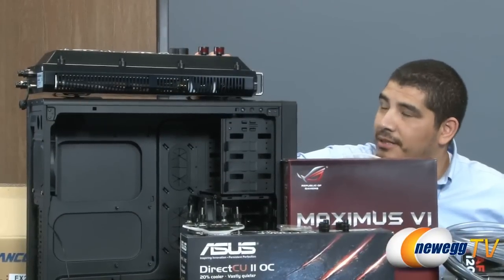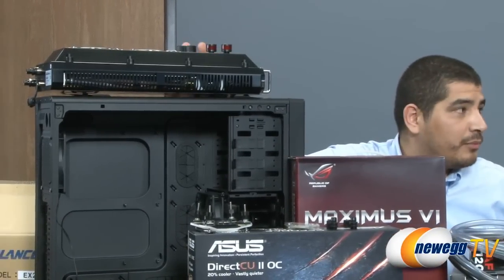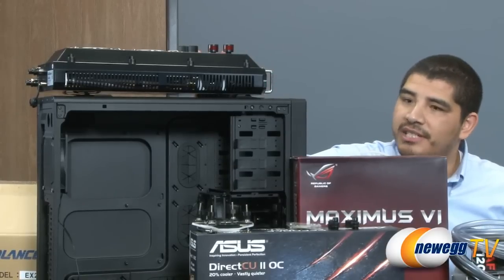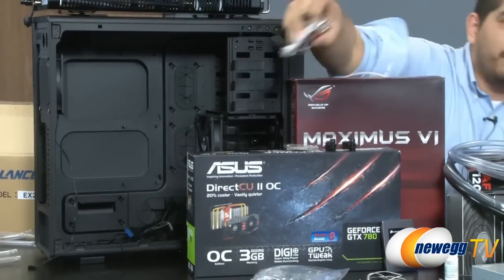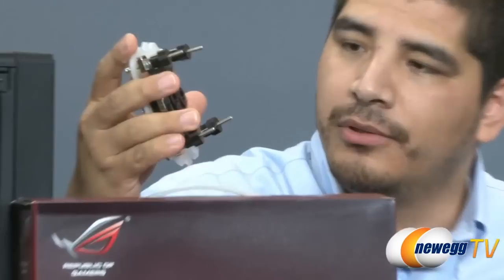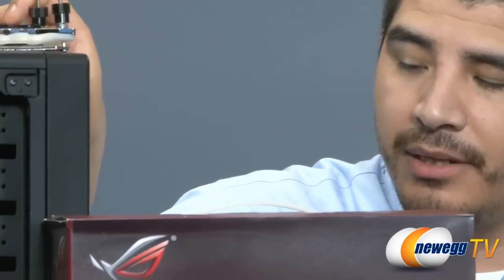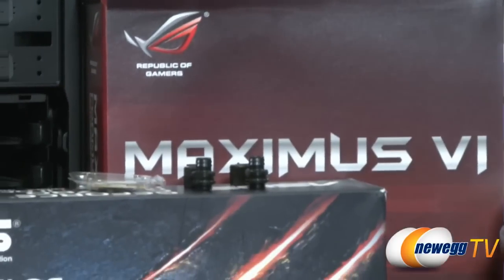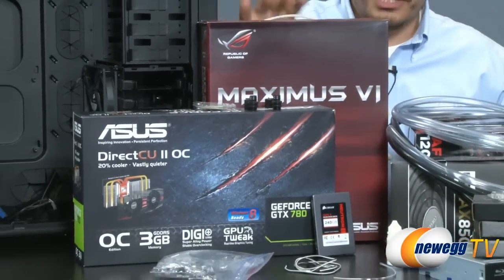So I got a couple of different things. I guess up here at the top, you guys will see that I got a Koolance Exos. This is the EXT2 755. So this is an integrated water cooling system. It's got the pump, the reservoir, the radiator. It's all internal inside there. And then I'll also be using that with a Koolance water block. This will be the Koolance 380i. So that's what I'll be using for the CPU. And I'll be setting up a complete loop setup. So we're going to cool the board using the cross-chill VRM cooling solution on here, along with the CPU.